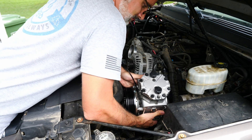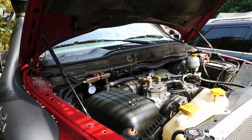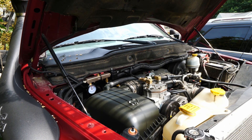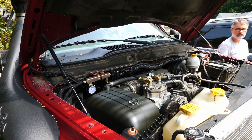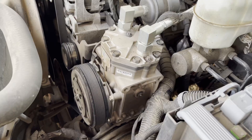A York compressor is actually built as an AC compressor — an old-time AC compressor that was used back in the 70s and 80s on most domestic vehicles. The Jeep crew and the Toyota guys figured out a long time ago that you could actually turn these into 100% duty cycle air compressors.